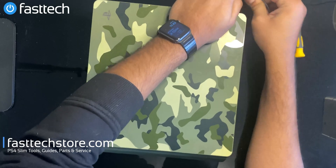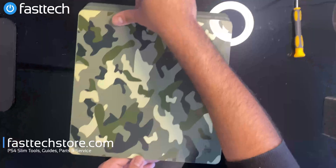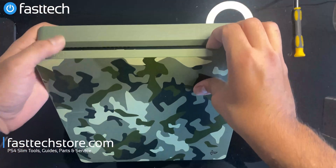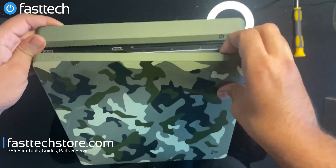Unplug the power cable and wait for the light to go off, which it did. Then we're going to lift this top cover off — stick your fingers in the front and just lift gently. Don't use too much force.